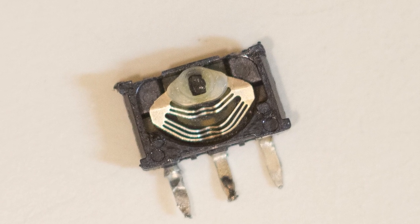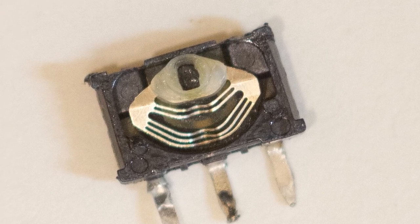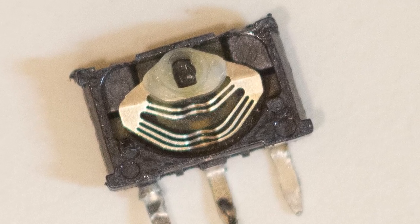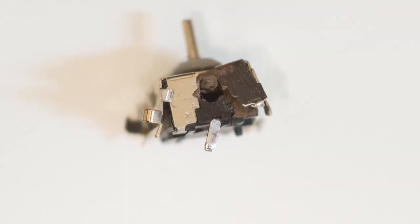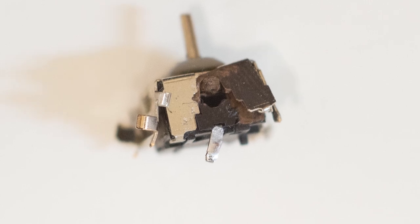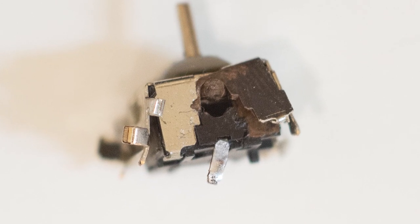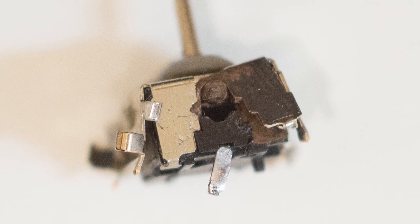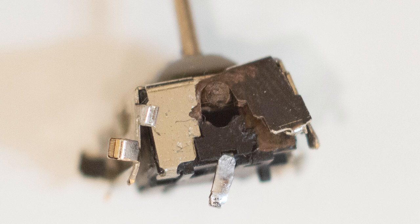Okay, here is the potentiometer on the side of that joystick. There's a little plastic part right there, and that starts to erode after a while as it's rubbing up against the shaft on the joystick. Both those pieces are made out of plastic, so eventually they tend to wear out, and calibrating your thumbstick doesn't really seem to work, or anything you do, because it's a mechanical problem.